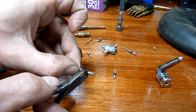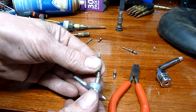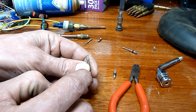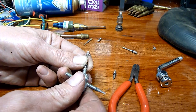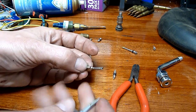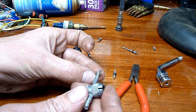You've got a valve body with a mechanical seal. This mechanical seal only works when it's tightened down properly, so when you take your valve tool and tighten the valve in, that pushes down tight and stays that way. If that's loose, the tyre will continue to lose air or the system will continue to lose gas. If it's damaged, scored, sheared off, or there's corrosion on the seat, it will keep losing gas. When you depress the valve, this little pin just pushes a little rubber disc off its seat, and gas passes through the inner passage and out through these holes.